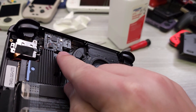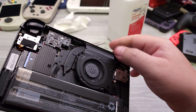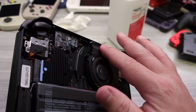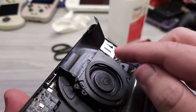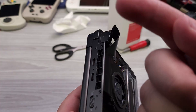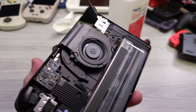Then I'm going to put it back together by hooking in the rumble motor and then powering it up, stepping through phases of a 10-watt burn-in, then 15-watt, then 20-watt, and capturing the results to see how much better PTM7950 is over the stock solution. I found some electrical tape and wrapped it around to make sure all the air is efficiently pushing through those fins. Then I'll connect everything and close it up for testing.